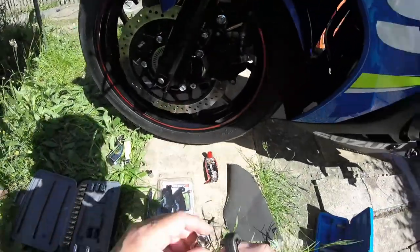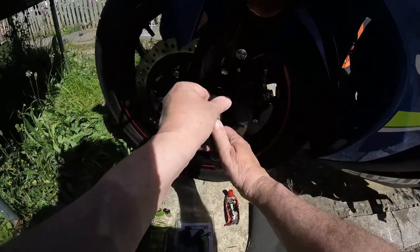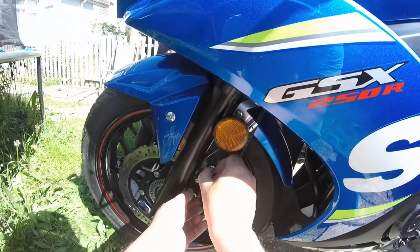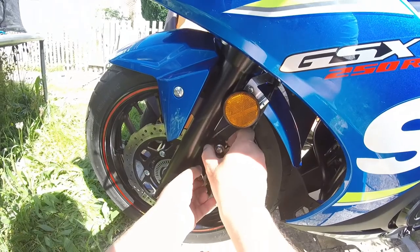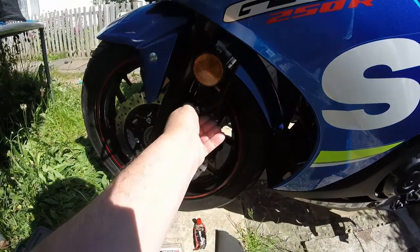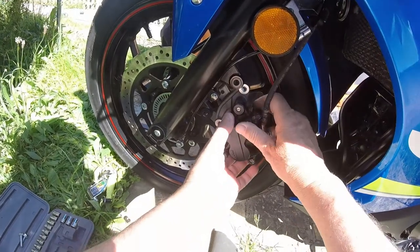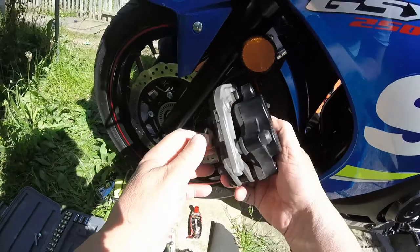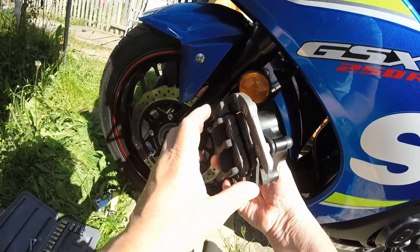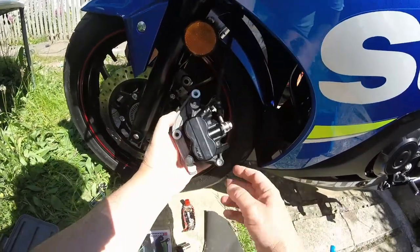Now 12mm on these two here. I've already cracked these off a little bit, so they're not as tight as they should be. Should be a nice easy job this — fingers crossed, I always get myself in a bit of trouble. Make sure the hanger comes off — make sure you don't drop anything. And there you've got your two pads. Like I say, the pads aren't that bad, it's just that they're a bit non-abrasive now. So let's take this pin out and I'll clean that pin up afterwards.